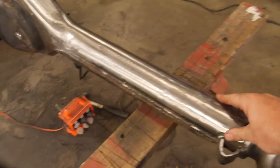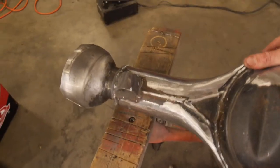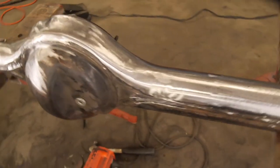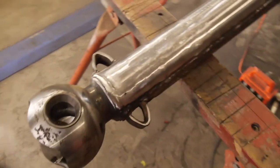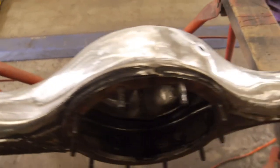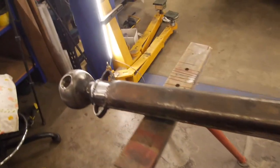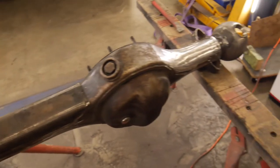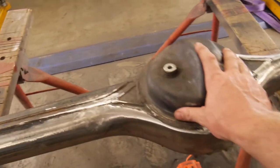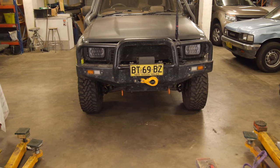A few hours gone and the axle housing is all cleaned up and ready to go. I was going to plasma cut the brackets but I didn't want to risk gouging into the diff too much, so I ended up using the grinder. I'll probably use the plasma more on the car. They came off pretty easily — only about four cutoff wheels, one grinding wheel, and one flap disc. Everything's prepped up where I know I'm going to have to add brackets. We can put this aside and now bring the car into the hoist bay.